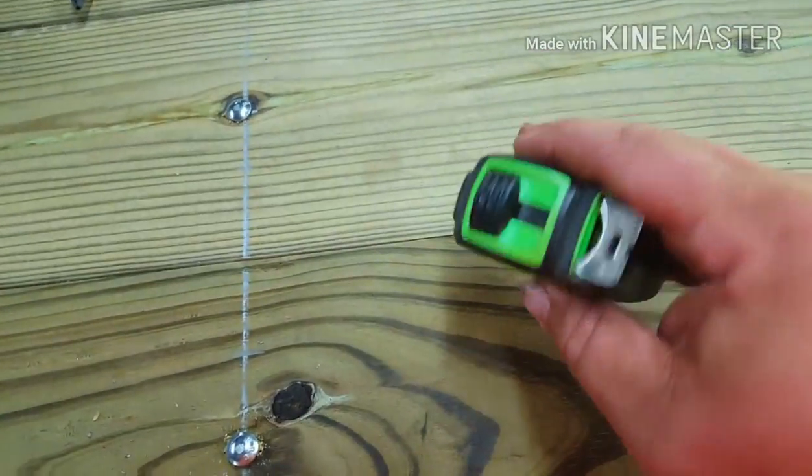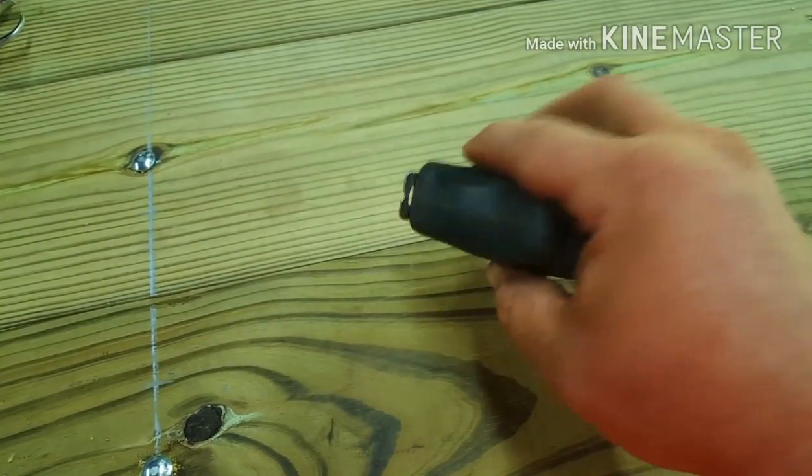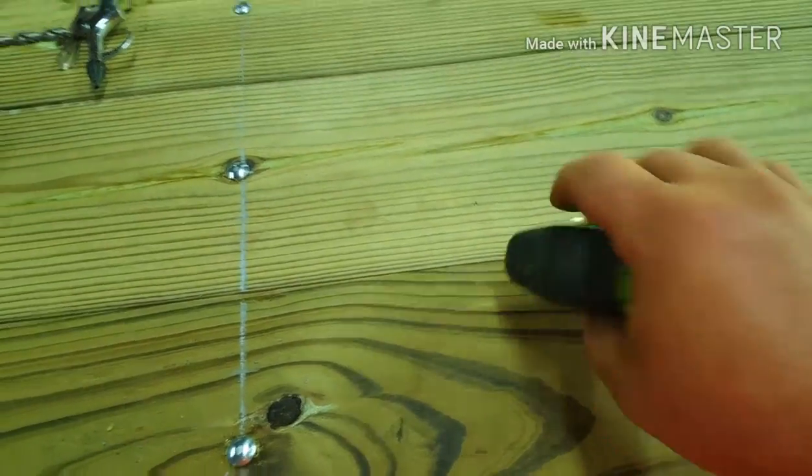And when they get out, you put a big wad of grease in the palm of your hand, and you just sit there. It's hard for me to show you with one hand on my phone, but say this right here is the bearing. You take that glob of grease that's in your hand and do like that all the way around and keep packing that bearing.